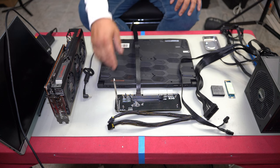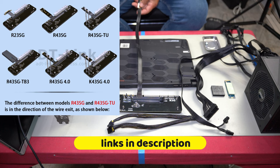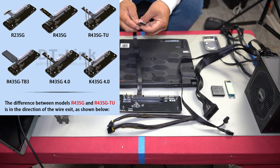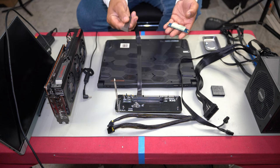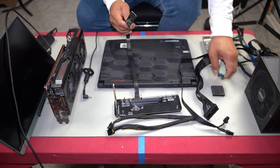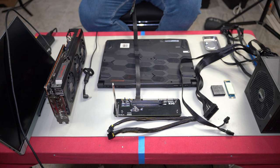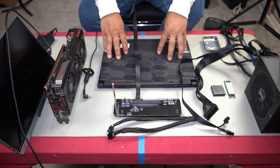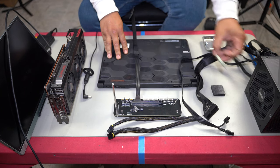To get this working, you need an external graphics card device, called an eGPU. One option connects via your M.2 NVMe slot, meaning you would remove your SSD from the laptop and plug the eGPU riser cable in there. You then need another way to boot Windows — if your laptop has a second M.2 drive slot, you install Windows on that and you're good to go.